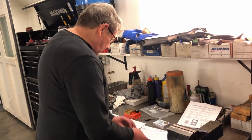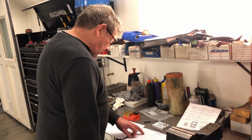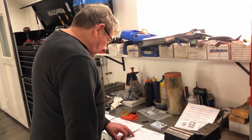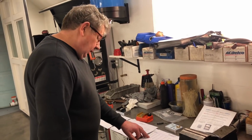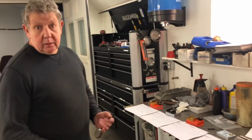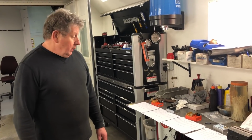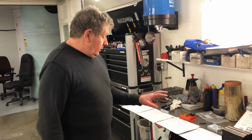and ultimately where we ended up with was a very stout number. Although the torque didn't exceed, let's see, best torque was 651.1, but this one actually made 675.9, might as well call it 676 horsepower. Again, with a good looking air fuel, but our blow-by numbers are continuously getting bigger, which means it looks like we have to go back into the motor and do some more checking to see why that's happening. I suspect that we have still water issues, but at the end of the day, we definitely proved that the Revator and the FBO box were definitely better.